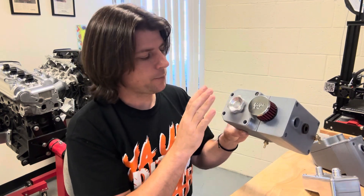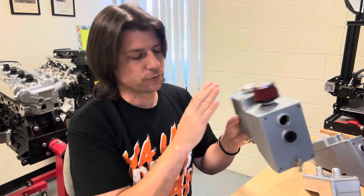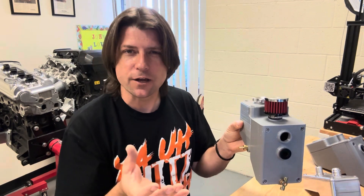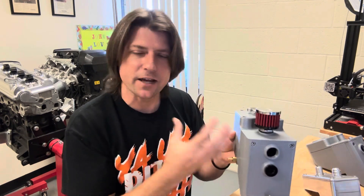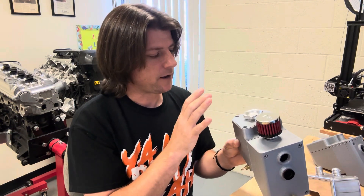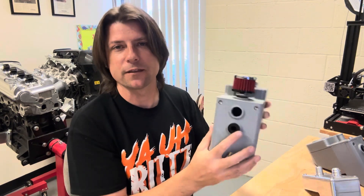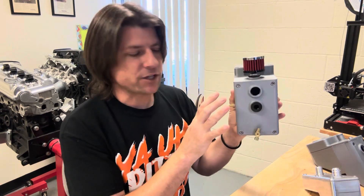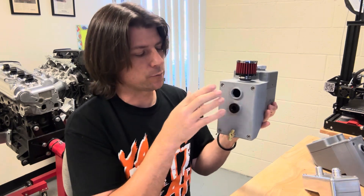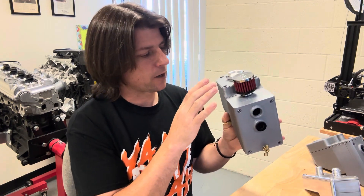We have the overflow cap on top. What I'm going to do is just have a small hole drilled in the top for ventilation — really just to allow fluid in and out without causing any pressure inside. If you're overheating your engine and the radiator is boiling over and the catch can fills up to full, the coolant will just come out the top of that cap and spill out in the engine bay, the same as if you had a factory overflow tube. Moving over to the catch can side, you can see it now has two AN fittings. You can plug one if you're only using one, or use both connected to the engine. Up on top, this is still the three-quarter inch breather fitting, which I am going to upgrade to the one-inch fitting.